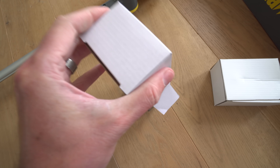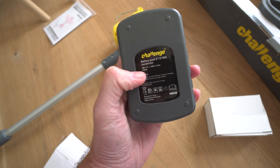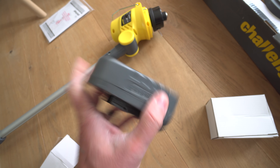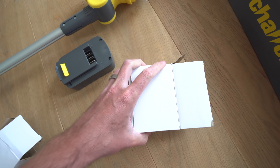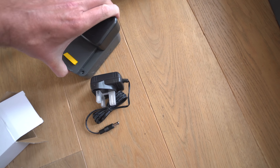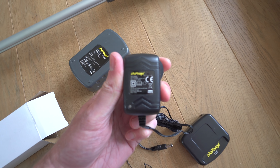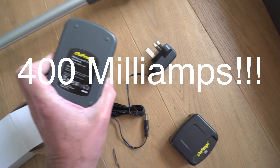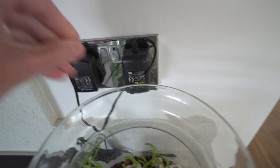Right, that's the battery - interesting bit. So this is an 18 volt, one and a half amp hour lithium-ion, 27 watt hour. Doesn't feel particularly heavy. Wonder what cells they're using there. This must be the charger - pretty neat, just a small little charger. Wouldn't be able to mount that on the wall or anything though. That's a 21 volt charger, kicks out 400 milliamps, so at one and a half amp hours it's going to take a few hours to charge. There's no lights on here but there's one on there - presumably that turns green when it's charged.